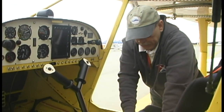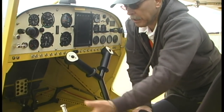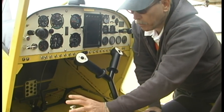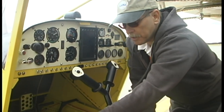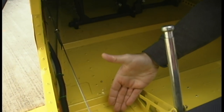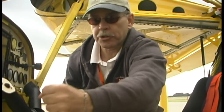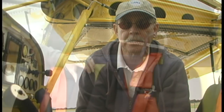There are flaps on this airplane. The flap handle is right between the left seat where the pilot in command sits — it moves back and forth for adjustment and is right up here where you can reach it easily. There's also a fuel cutoff switch right down on the floor. The company also offers a dual joystick arrangement, toe brakes on both positions, and instead of mechanical flaps you can have electric flaps operated by a panel-mounted switch.